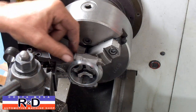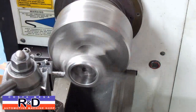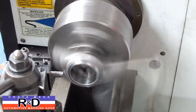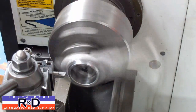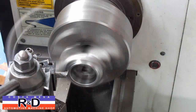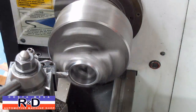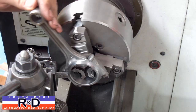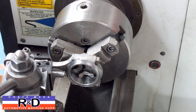I think we're going to go ahead and cut into the bolt here a little bit. There's plenty of room on this bolt as far as having surface area. We're doing a total of 150 thousandths. Right now we're taking another 20 thousandths. Now we're just starting to touch the bolts there.